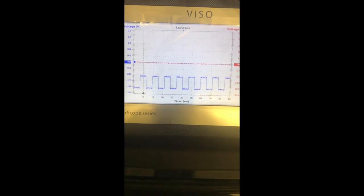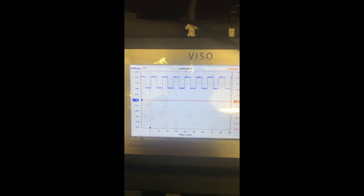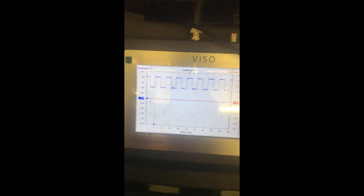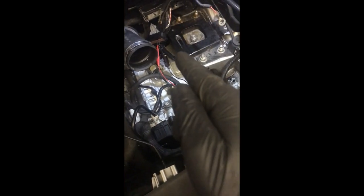And we're going to plug the scope into the ABS, and we're going to check the signal. And apart from having the polarity reversed, which isn't a problem, soon change that, these around the other way. And there, what have we got? The same signal. So, using the signal generator through the ABS wiring, through the harness, up to the plug, coming out of the plug, perfect signal.